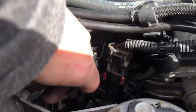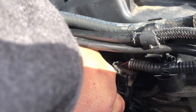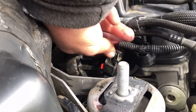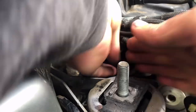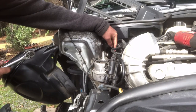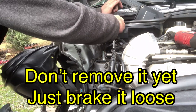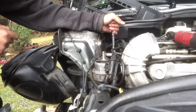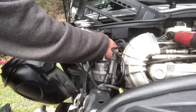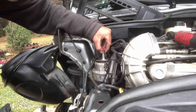There's a little clip on the side of your head. Take the red part and pull it out as far as you can by pushing the small button and pulling. Next up is the 16 millimeter bolt on the back of your motor mount — I sprayed some penetrating oil on there earlier. You might need a breaker bar. If your motor mount looks like mine, you need a new one.